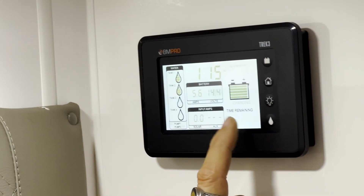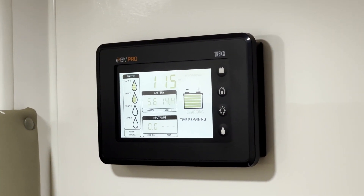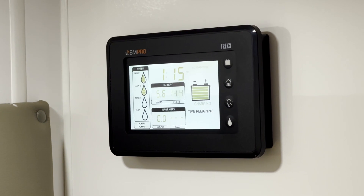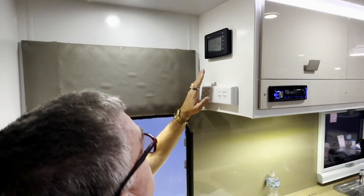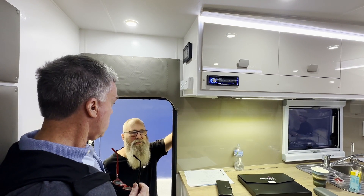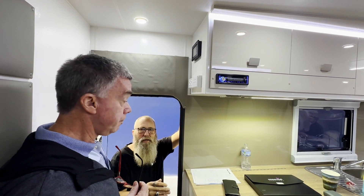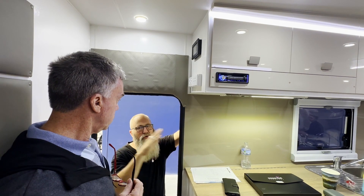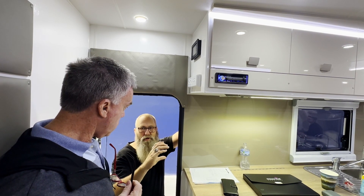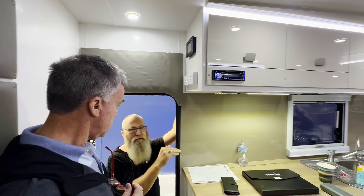These indicators are not really accurate — they'll give you an idea of battery levels, but the 'time remaining' reading works off the solar, so on a lovely blue sky it'll say 199 hours, then a cloud goes over and it drops to 20. Don't pay attention to that. Look at the volt meter — keep it above 12 volts when you're off-grid. If it does shut down, the only way to reboot it is to plug into 240, because solar won't reboot it. When the 12V turns off, it includes your fridge even if it's on gas, because it runs on a 12V LED display panel.